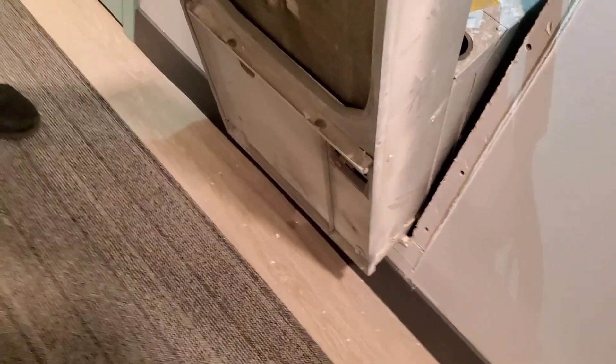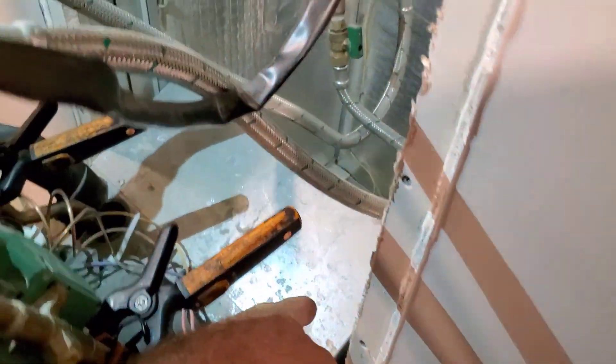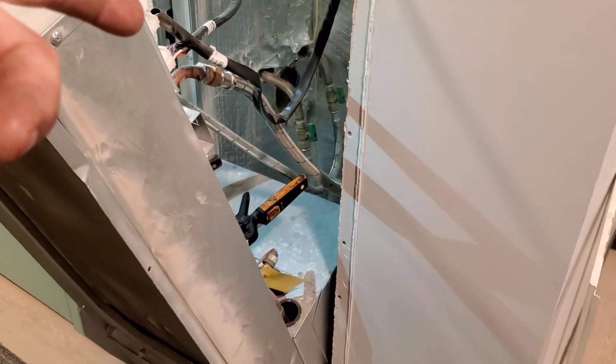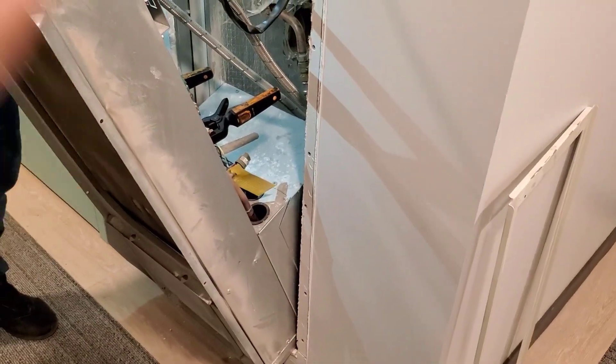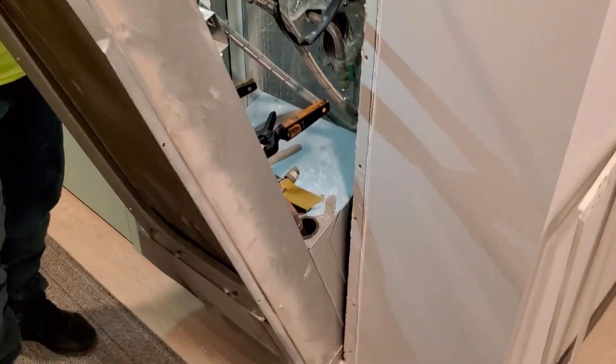To get to the compressor, you don't get to it from here — that's just a circuit board. To check any pressures you've got to pull this unit, pull the back cover off, which is screwed on three sides. Most of the time you're having to turn off the water, disconnect the water lines to get this out, pull out the unit, get to the compressor compartment, put your gauges on, put the unit back together with the water lines — then you can check the pressure.